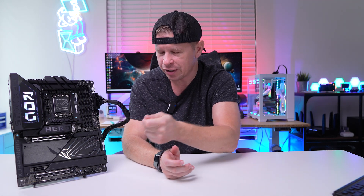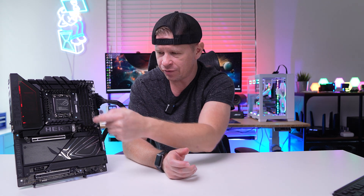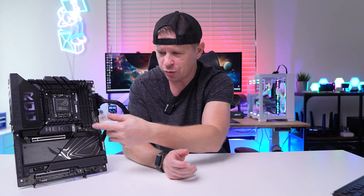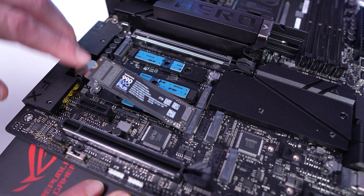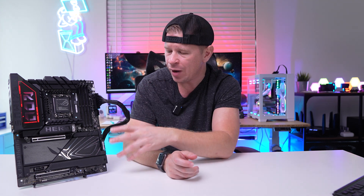I really like the Nitro Path DRAM. I also love the ease-of-use features — the quick release for the graphics card is amazing. There's no button, you just pull it one way and it comes out, pull it the other way and it stays locked. It allows for more room on the board and means you don't have to try to fit your finger between your CPU cooler and the side of the graphics card to release it. All of the M.2 slots are essentially tool-less — I would have liked the bottom heatsink to be tool-less too, but you do have to remove four screws for that.